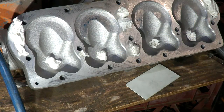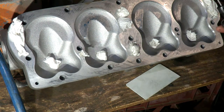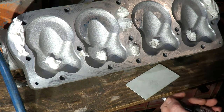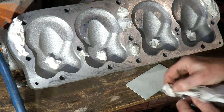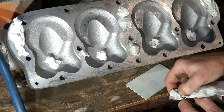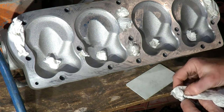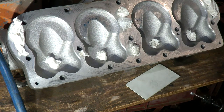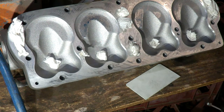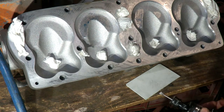Back in the other workshop to start grinding. I'm using a high speed die grinder with just a small cutting tip, just cleaning off some of the remnants of the previous cuts. There are two ways you can do this: you can see where it's hitting and get really stuck into it and take a lump out — that's one way. I've chosen not to do that. I've chosen just to skim the areas where it's actually touching — and I mean skim — and then retest.